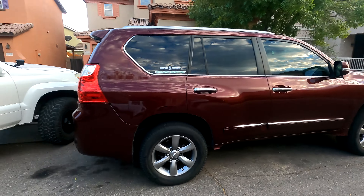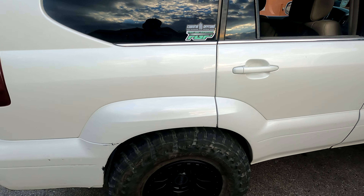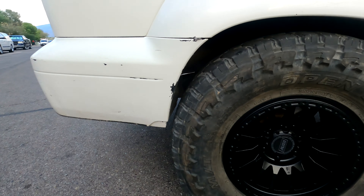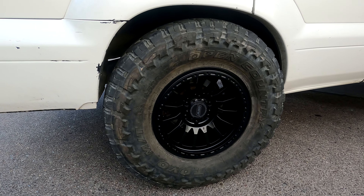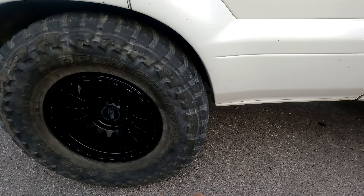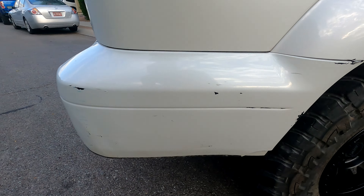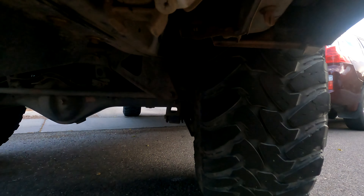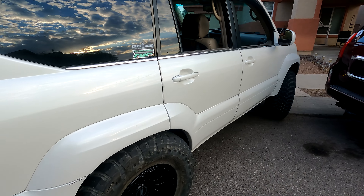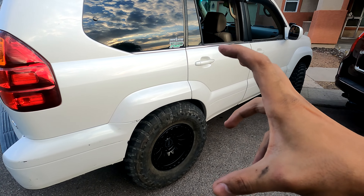Here's a look at the current fleet and the Lexus just flexing into the driveway. When the axle moves up in its travel, looks like I'm clearing up here pretty good, and clearing in the back pretty good too. All I'll have to worry about is bump stops — I'm a couple inches away from them, so after I get taller springs I'm going to want to get duro bump stops, like plus 4 or 5 inch bump stops for the rear.